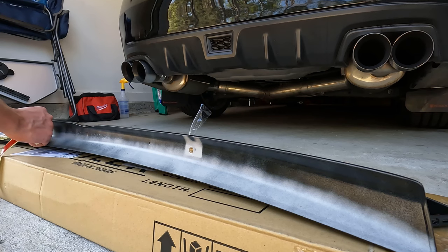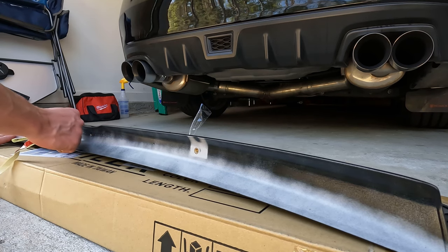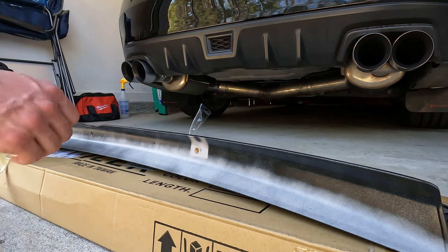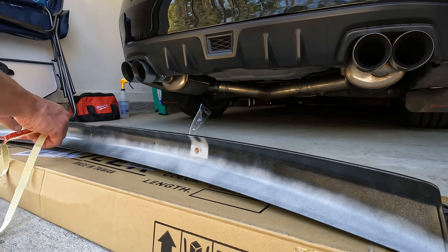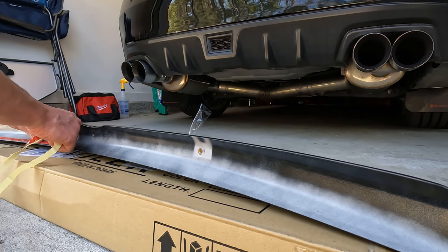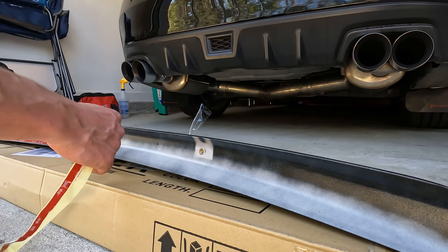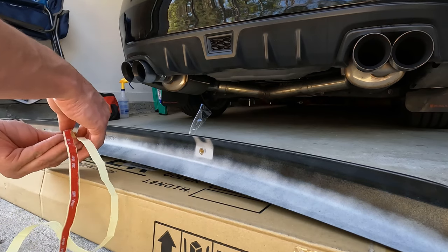The process you're seeing here — I'm just really trying to align that tape all over the bottom end of that duckbill, and afterwards I will do the same on just the upper sides. You'll want to leave just maybe a couple millimeters of space on top and bottom so it's not exposed once the duckbill is installed on the trunk lid.